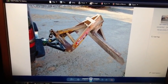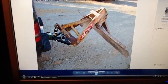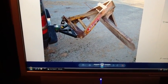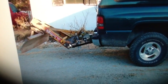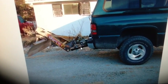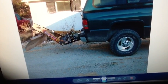This is a picture of a design I found on the internet that started my idea. You'll notice the length of the hitch portion that has to be there to run the three-point hitch. That makes it stick out a lot further than what I really wanted. You'll also see the three-point hitch part that I've cut off of mine to simplify storage. Notice how far this has to stick out behind the vehicle to get the pull for the three-point hitch. I was trying to eliminate both this length for safety and the weight on the hitch, and also eliminate the three-point hitch portion for storage.